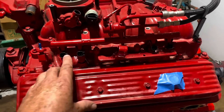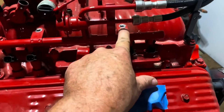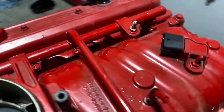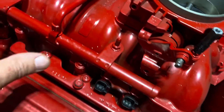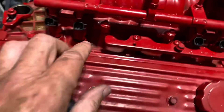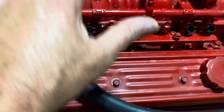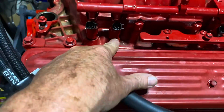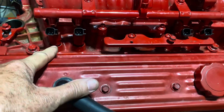I'm fixing to take these fuel rails off. There's a screw right here and right down there — there's another one there. These are actually studs, not screws, and another one here. So you take all four bolts holding your fuel rails down and pull the fuel rails — you kind of have to wedge them off. You can get a flat blade screwdriver and wedge these fuel rails up and pull your injectors out. Take a blow gun and blow out the holes where the injectors are so trash doesn't fall down in there and hole your engine.